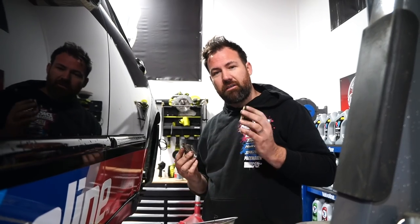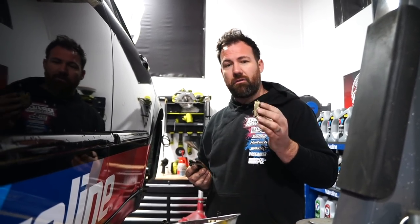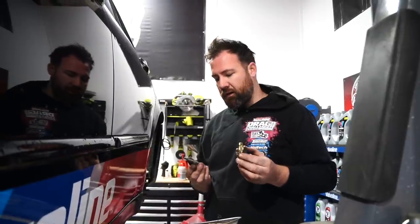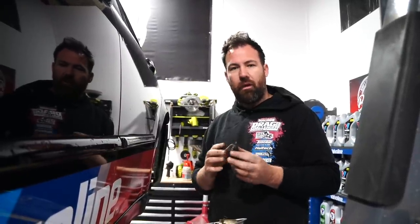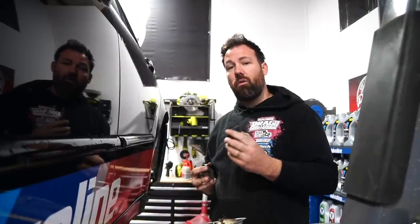You may be wondering why we're actually changing the brake pads. Well, these WinMax W3s are quite a good circuit pad, but they don't bite particularly well from dead cold. So we're actually going back to this Forza pad. I think it's just like an FP1 or whatever. It's more of a street track pad, so it will handle some heat, but it should grab a lot earlier and a lot colder on a hydraulic handbrake.